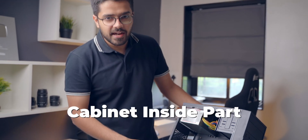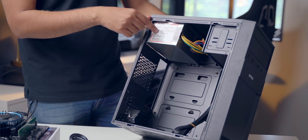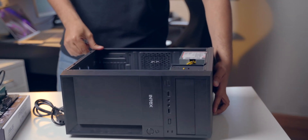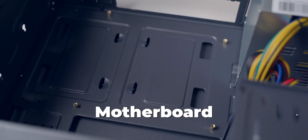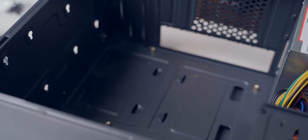This is the inside of the case. You get the power cable first — this is very important. This is the power unit. This is a very basic power unit because this is a very basic PC — if you go with a high-end PC you will need a high-end power unit. Inside the case you also get a very important screw packet — you do not want to lose this because you need screws to mount everything inside. There are already four standoff screws inside the case for the motherboard. You place the motherboard inside, tighten the screws, and you're good to go.